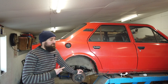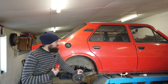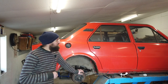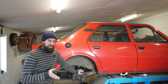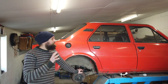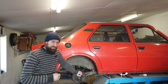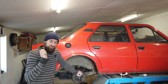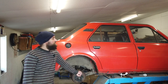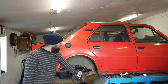My plan is to drain the coolant and depending on how it looks, I'm just going to fill it again. If it looks really bad, we'll most likely have to flush it. I'm also going to change the thermostat and take a look at the water pump — it's a bit funny on this car, I'll show it later. I got comments saying the thermostat on the radiator that kicks the fan in tends to not work on these cars, so I'm going to take it off and test it, and make sure the fan itself is working. It would also be nice to just have a little break on the brake job. Let's get to work and start underneath the car.